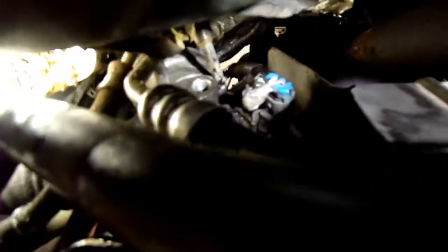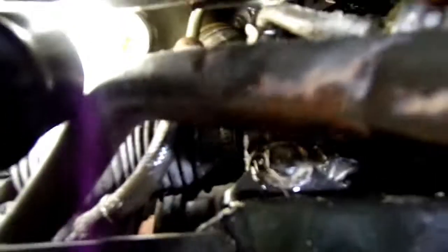Okay, I was going to try to start pulling this line down. It wouldn't come down because this pressure line is in the way. So we're going to have to remove that pressure line where it hooks to the rack and pinion right here where my finger's at. This way I got it broke loose, but I used that same ratchet and crow's foot to get it loose. And don't forget your O-rings when you go back with new lines. They'll have O-rings on the end of these hoses.